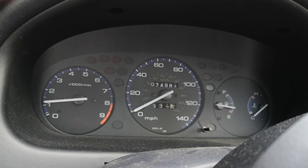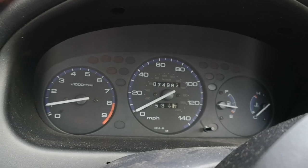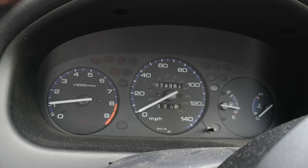Check for engine management lights - this is a more recent legislative change where engine management lights can cause an MOT fail. The concern is that the vehicle could break down and be left in an unsafe position. MOT testers now look for amber warning lights on the dash; a red light would normally also be a fail unless it's a normal operational light like the handbrake light. They'll check for any check engine lights to make sure the vehicle is fully operational.